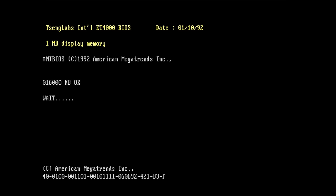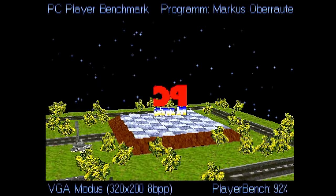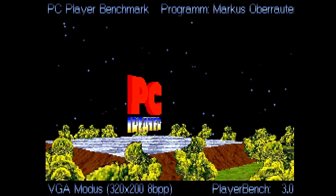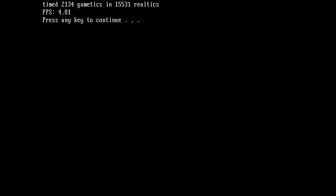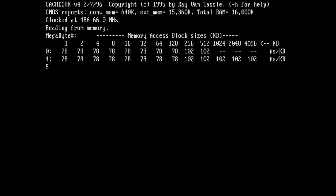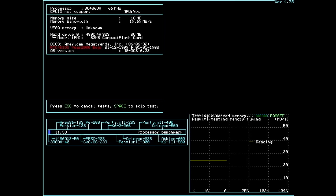Now let's talk about benchmarks. I thought this would be quite easy, but I was very mistaken. First, I tried to figure out how much slowdown we get when the turbo feature is off. PCPlayer looks like a slideshow and finishes with a score of 3 frames per second, and the same is true for Doom — we remain below 5 frames per second. In cache check, we can see how this board implements the turbo feature — the access time up to 128 KB remains identical, meaning we don't have any level 1 cache. This is confirmed by the summary at the end of the benchmark.